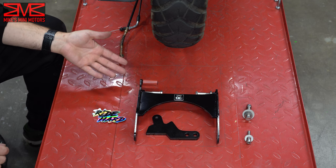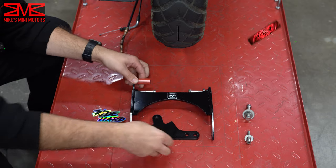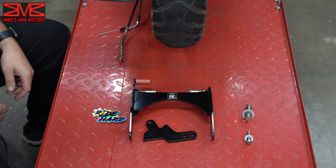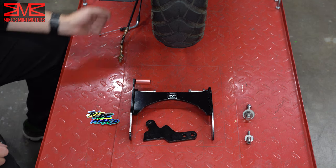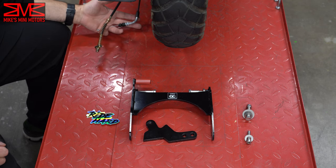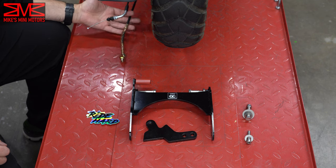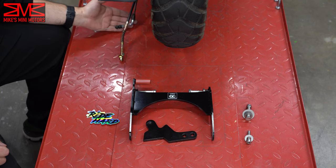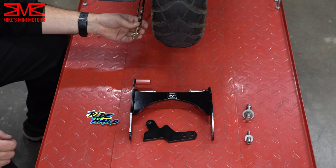Here is the stretch kit from Small Fast Things. You can see you got the main stretch bracket here, your new shock mount, some bolts and all the hardware you need, and it even comes with a sticker. One thing they also offer as an option are these extended brake and throttle cables. I did decide to add those on after seeing on my C3 how I wish I would have. So I went ahead and installed these since I had all the panels off when I was doing the painting — why not have the extra space just in case instead of trying to stretch them.